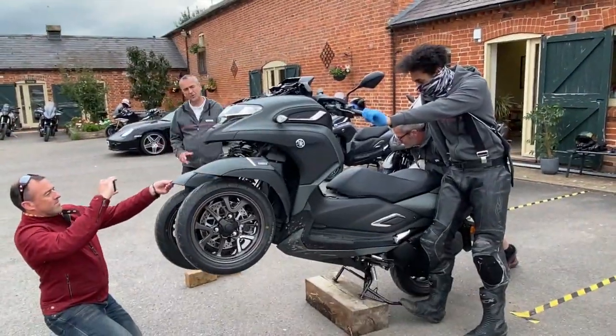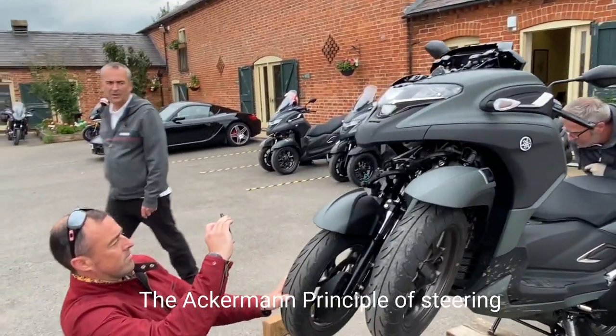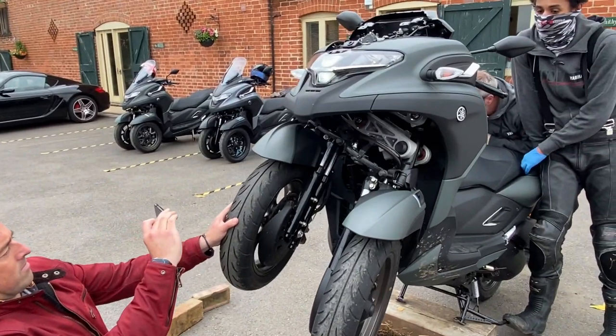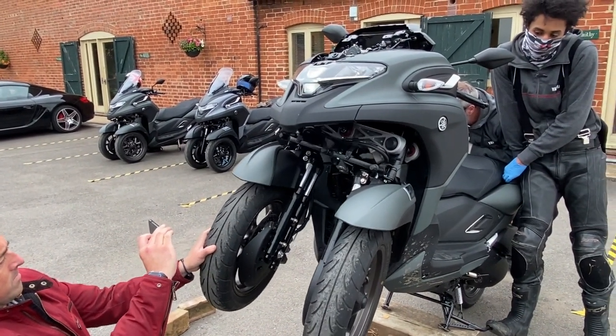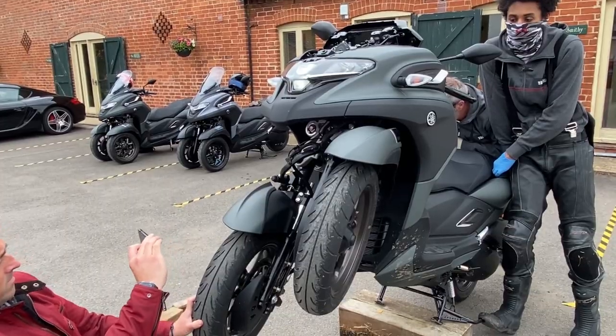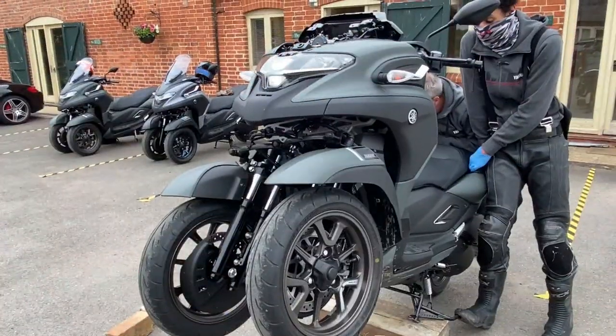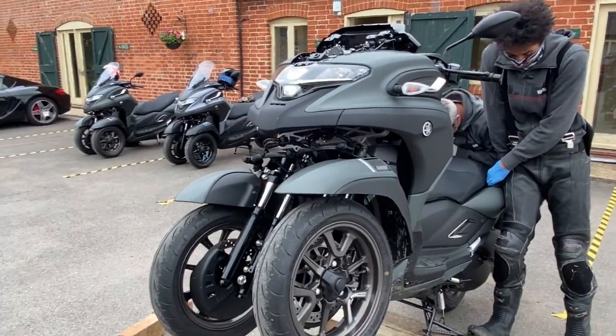While you're doing that, you turn the steering as well. You can actually see — this is what is known as the Ackermann principle — whereas the inside wheel has to turn in a tighter radius than the outer wheel. And that's simply done by the geometry of the linkage. And that's where you get your natural riding position from, your natural pitch.